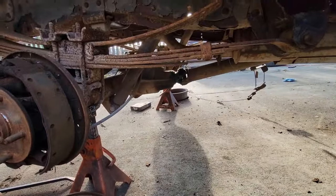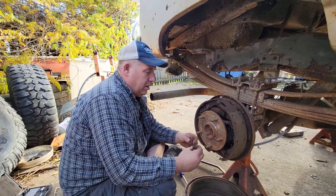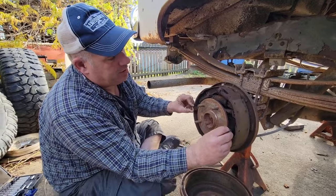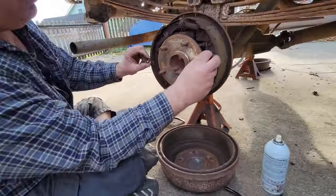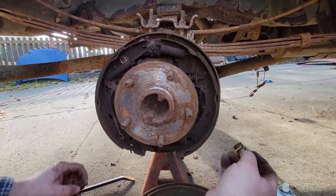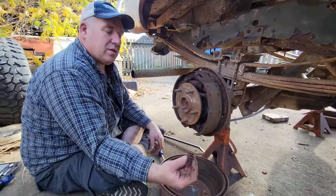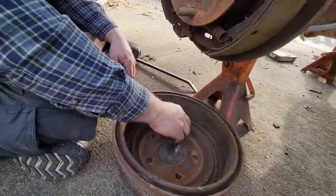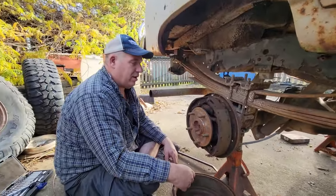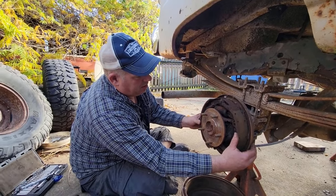Did you see the brakes when you took the other half off? But the drum didn't come off with anything. Yeah, I know. Like this one. Anyways, what happens is these are here and they hold the brake back, right? And you can see they haven't been on there for a while. So these probably failed. The brake got weird in there, and that's what was all my trouble. When we took it off, those were in there. Yeah. But these weren't, see, these haven't gone round and round. So most likely, since it was sitting in that field or in my driveway, the spring tension released those pins. So it's not the end of the world.